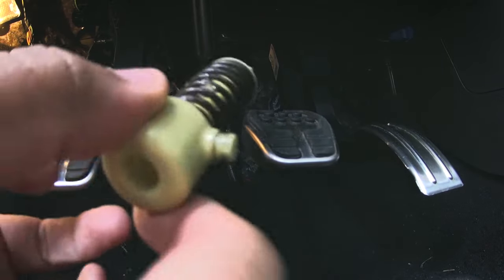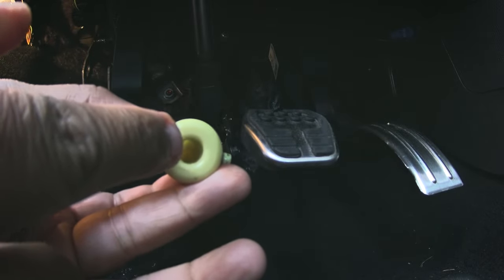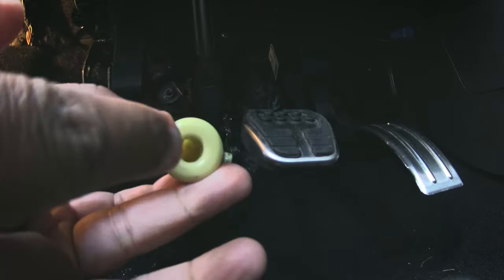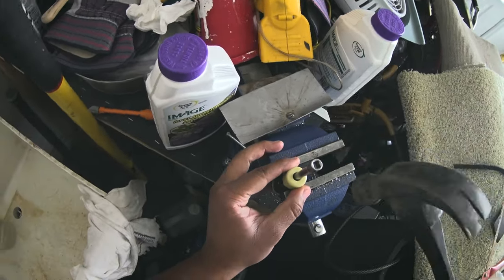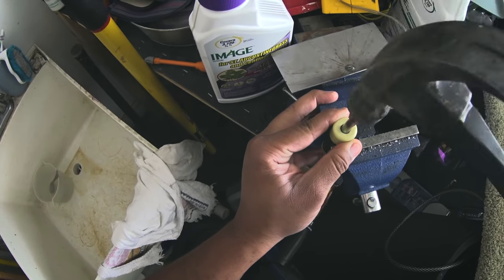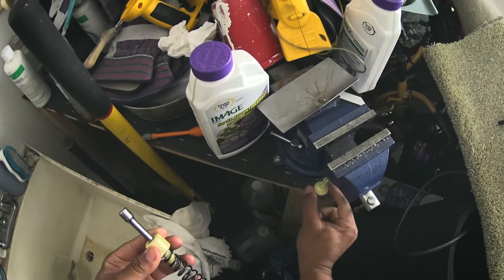What we're going to do is put this on a vice. On the inside there is a line that looks like a slot for a flathead screwdriver. I took a flathead screwdriver and turned it until that line was equal to the tabs on the left and right. Then I took the socket extension bar, stuck it in there on the vice, took a hammer to it, gave it a couple real good hits — don't hit it too hard — and it popped right out.